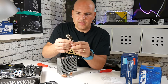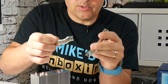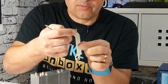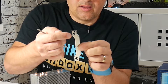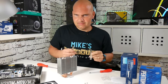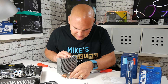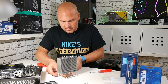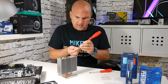In the kit you get these universal brackets — you use them one way round for Intel and the other way round for AMD. There are three holes: AM4, AM3, 1151, and 2011. Put the clamps on with the holes on the outer side, then get your screwdriver and put your screws back in.